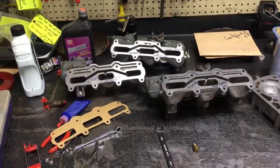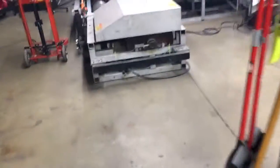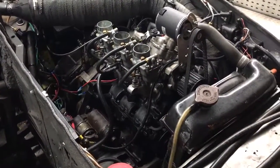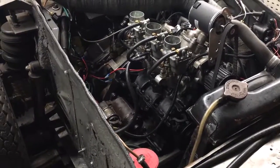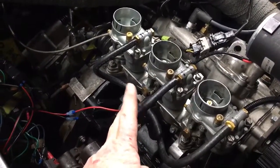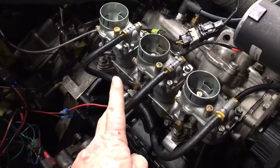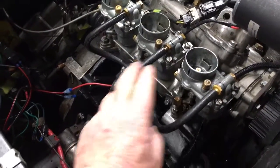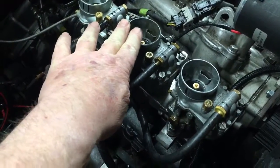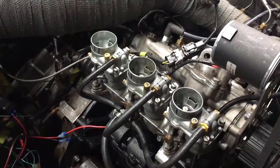The only variable I don't have in this test is I don't have an air cleaner on, just due to the way everything's set up. I'm going to run a '96 that hasn't been heavily modified, and I've got an extra set of triple pipes I'll put on that and run it to get better test results for everybody. But I think for now, if it was me, I'm going to start running 15 points higher in my center cylinder — 15 higher on my main jet. So if I've got a 125 on my outers, I'm going to go a 140 in the middle — 15 points higher.